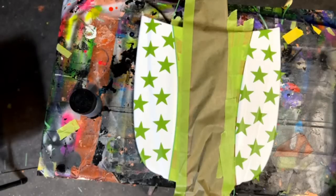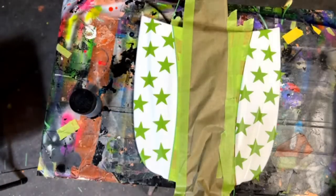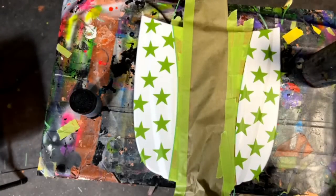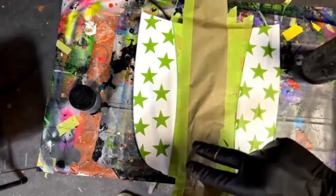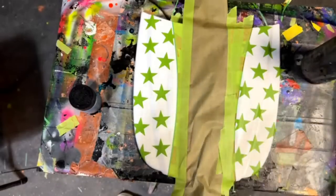Then someone said, can you use candy in clear coat? The answer is yes, you can use candy in regular 2K clear coat. However, you need to be real careful, because candies in clear coats take a while to dry, unlike regular clear base coat. If you spray it really wet, it could run, and when it levels out you could see where it ran.